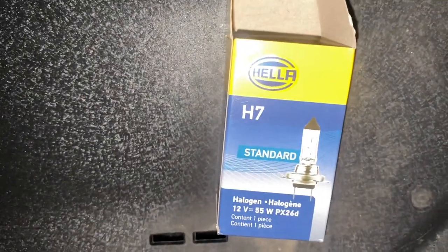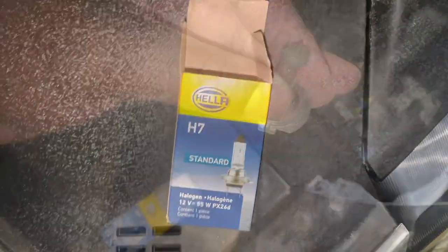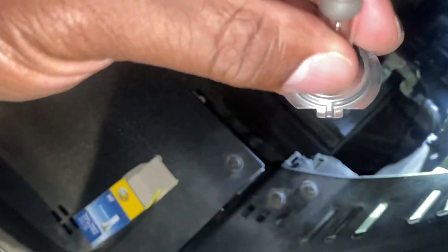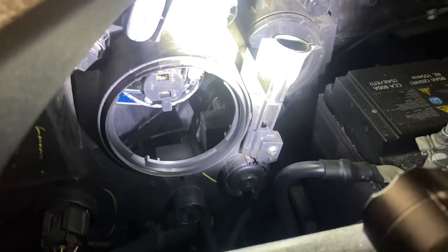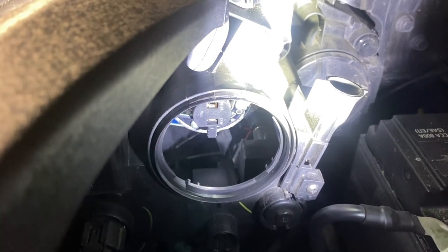It's 55 watts. I'm going to change this for an LED light, but this will work for now. There's a little notch right there — as you can see, this side doesn't have it, this side has the notch. You just line that up with the notch that's on the receptacle and you're good to go. Once you get it back in, it clicks right back into place. Now let's check to see if everything is fixed.